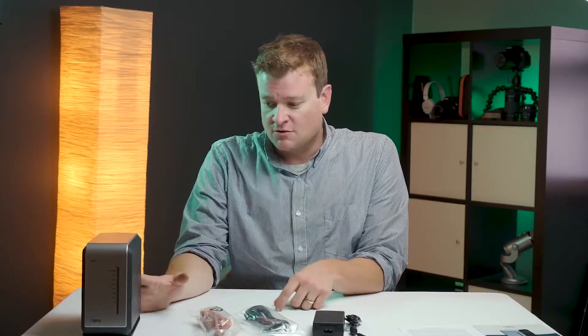That's about 10 pounds heavier now with those two drives. One thing I'd like to mention — don't ever use normal hard drives in these units. They will not last long. You need to use the compatible hard drives they recommend or something similar for a NAS unit. Normal computer hard drives will not be well suited for these units.